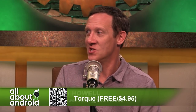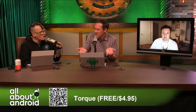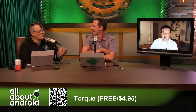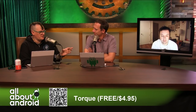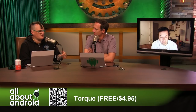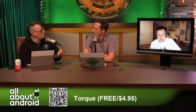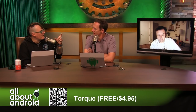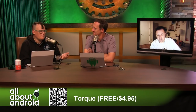Pretty much all modern vehicles — and by modern, we're not even talking that modern — 1995 and up is the standard. Some cars before 1995 also work because they were starting to implement it a little earlier. Sometimes you'll need a different physical adapter depending on the manufacturer. I have an old Volkswagen camper van that's pre-95 but does support OBD. You just need a pigtail adapter because the connector wasn't standardized yet, but the protocol works. I can see basic things like RPM and a bunch of other stuff.